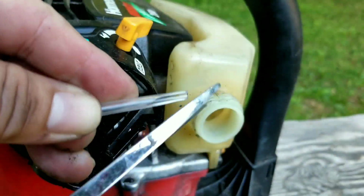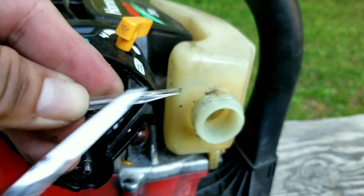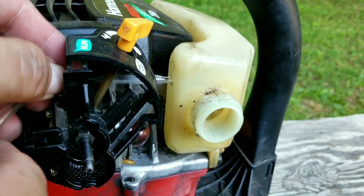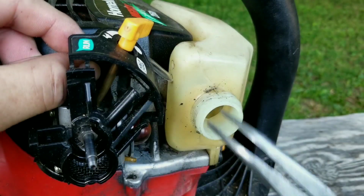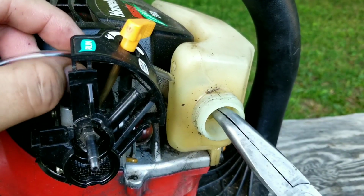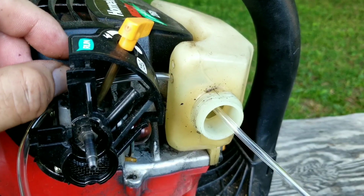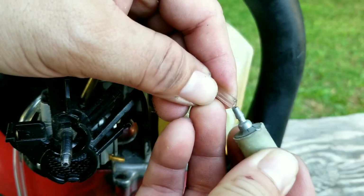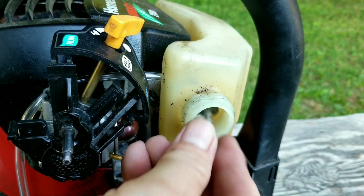Now, to install the new fuel lines, first cut the lines at a very sharp angle to help get them into the holes into the tank. Next, pull the line out of the tank and cut the angle piece off, as this one will be our filter line. After reconnecting the filter, push it back into the tank and do the same for the return line.